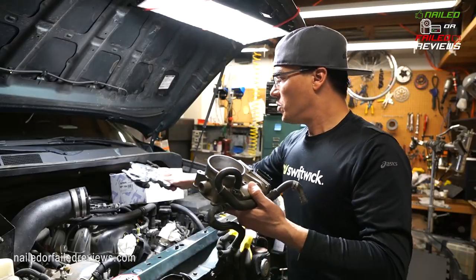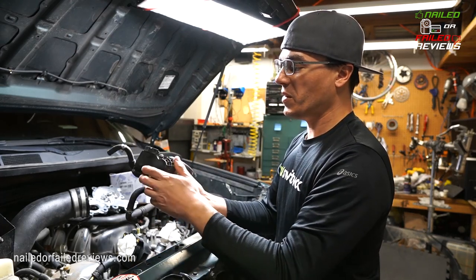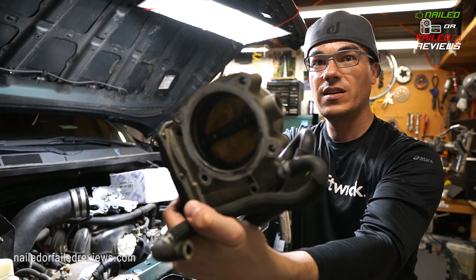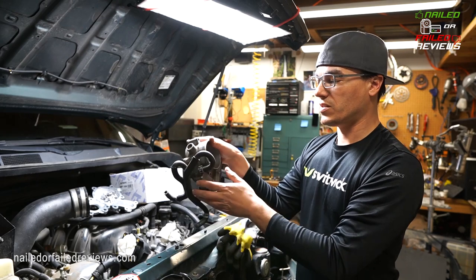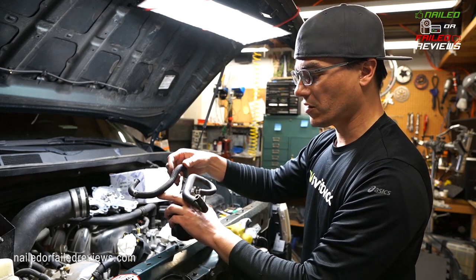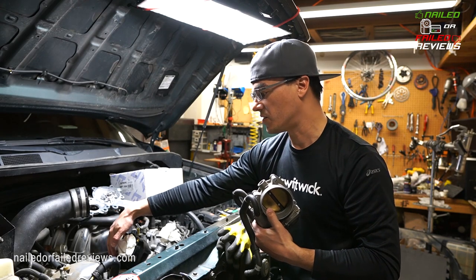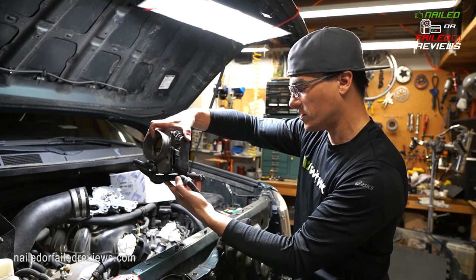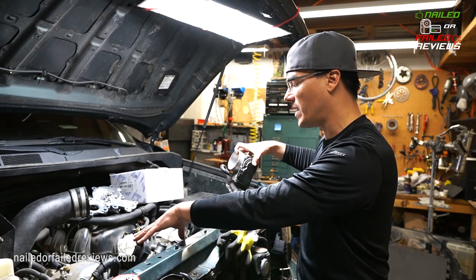Okay, so you're gonna wanna remove the throttle body, which is gonna be this whole piece here, mainly because of these other hoses. It also gives you the opportunity to clean it. You can see how dirty this throttle body is here. But leave the hoses that are attached to it. Don't mess with those unless you see they're cracked or something. They're pre-shaped to fit specifically down into this area under the throttle body itself. So these are tucked in here like this, and they attach to this other component of the cooling system that goes between the two heads.